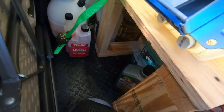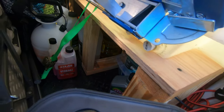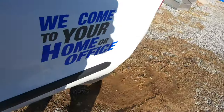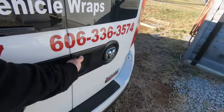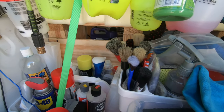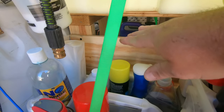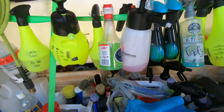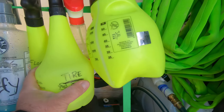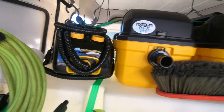Down here you can see I have a little ceramic heater. It blows under the water tank. I have chemicals and that sort of thing underneath, and that keeps all of that from freezing. It blows through the back and circulates around. We've got vent holes here, chemicals, heater up there — the air blows out, circulates around, and keeps all of this stuff from freezing. It's 30 degrees outside today and it just circulates and keeps everything warm.